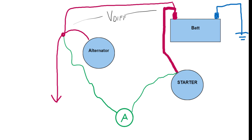The green wires, or actually they are black and white in real life, pass the firewall twice, and there are a few points related to this. The ammeter circuit is always on, always hot. It's independent of the ignition switch. It's totally unfused, and it has a two-direction, or dual direction, power supply. If there is a failure at the firewall, for instance, it will feed the current from both directions.